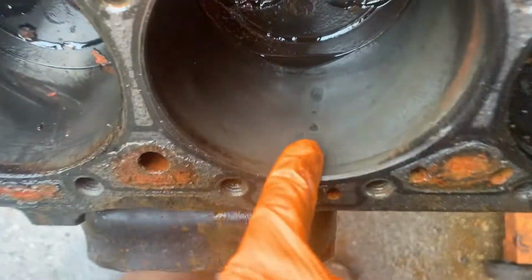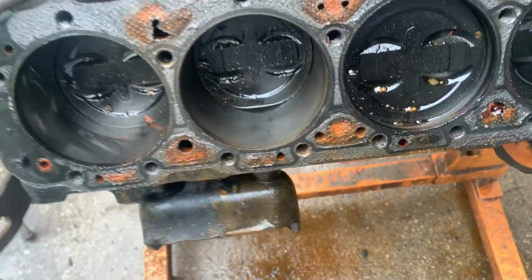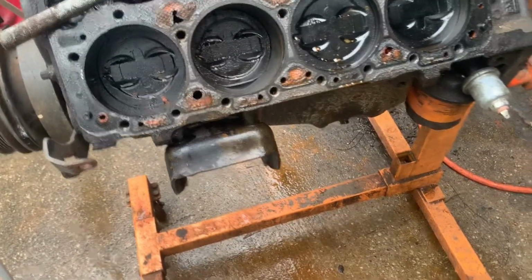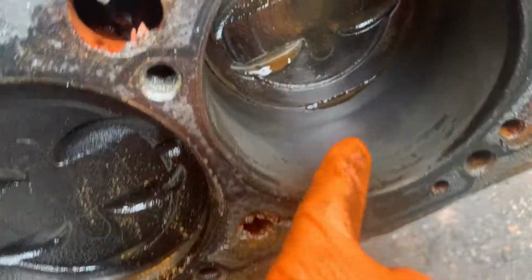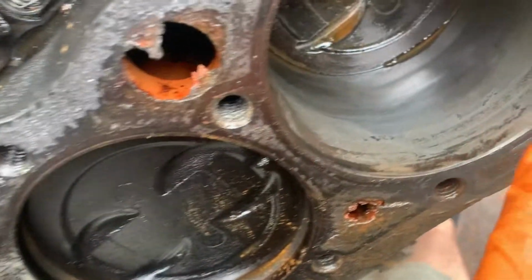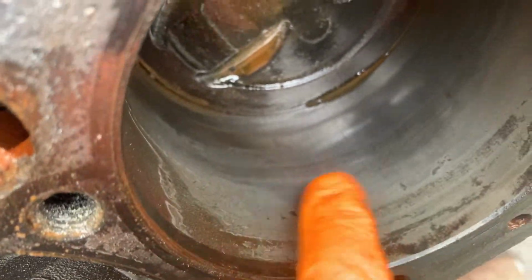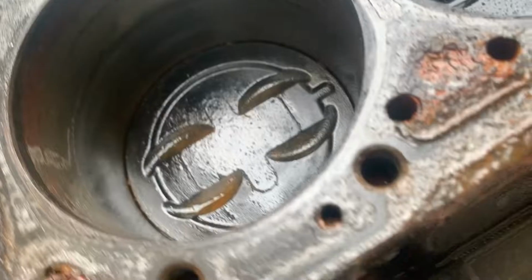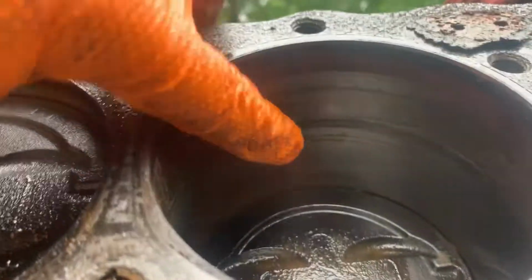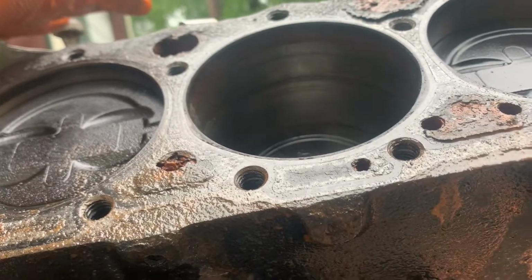And motor spinning now. It does have some staining. I probably wouldn't feel comfortable just honing it. We could try it, but I really think it should be bored. You know, it's pretty dirty, but it's not awful. But it definitely has a bit of pitting. You can see up there. You can see it lines pretty bad. So it would probably need to be bored.